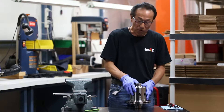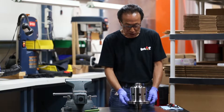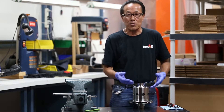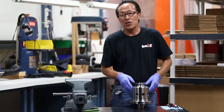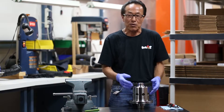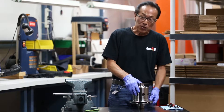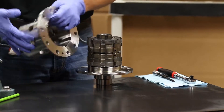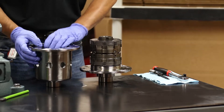This is the Ford Mustang unit and it has 16 plates inside. This unit you can adjust it at 100% lock, 80% lock, or 65% lock to make it more mild. I'd like to show you how the plates are configured to achieve that setting.